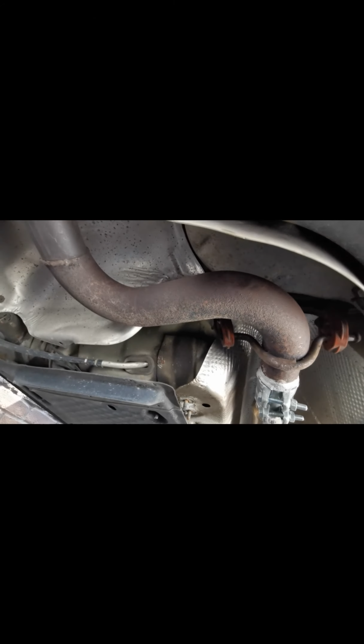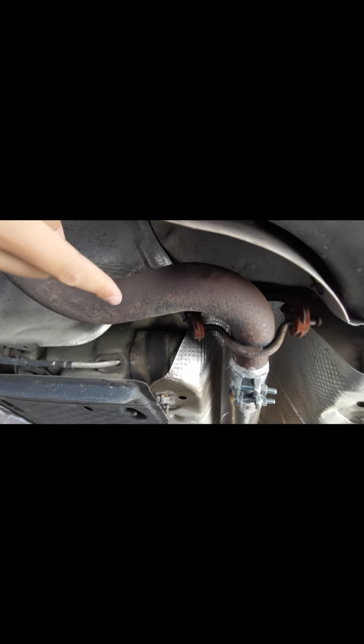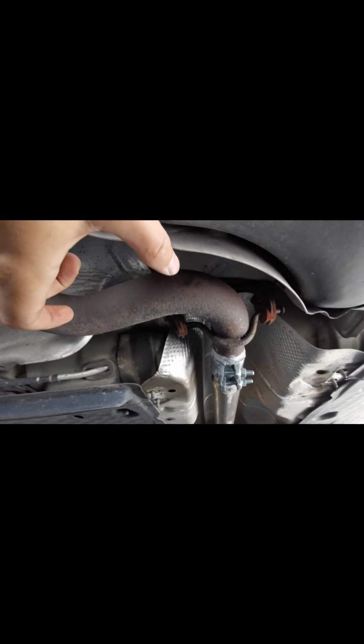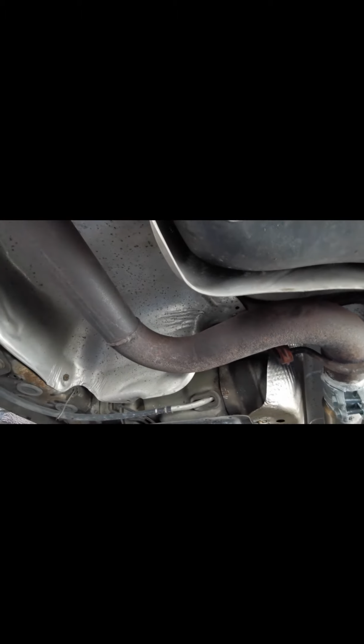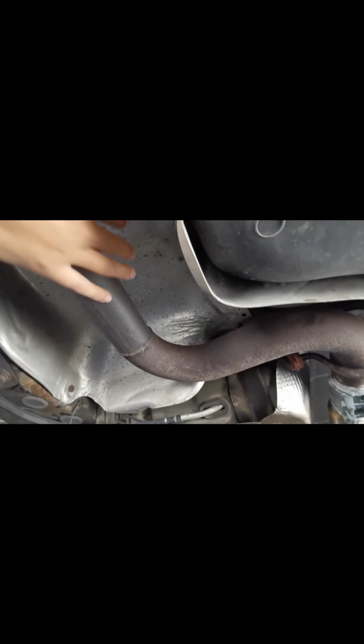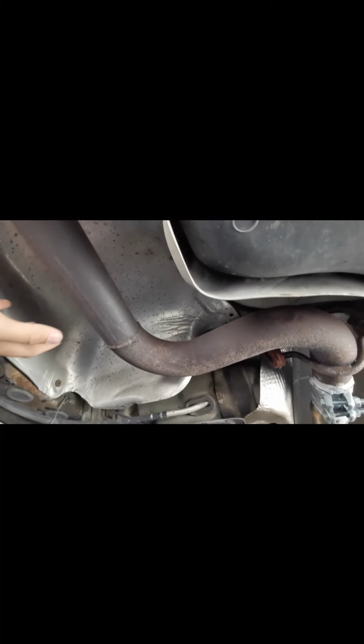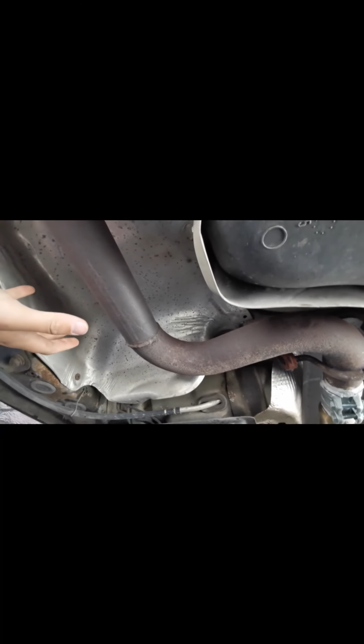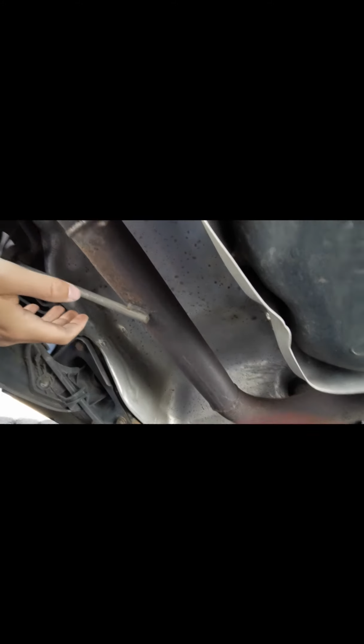So yep, as I thought, we're going to need a 90 degree bend to come round from this bit here, and then probably maybe a 300mm piece of stainless, then another 90 degree bend, which will be over here into our silencer. Now we've got obviously all this massive area here to fit the silencer in. We want to keep that as big as possible because I'm not wanting a massively loud exhaust, just something enough to make it a bit nicer sounding than it is at the moment.